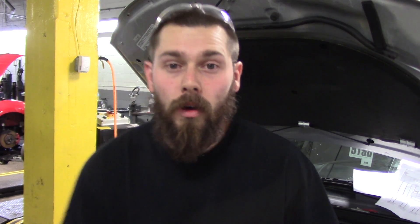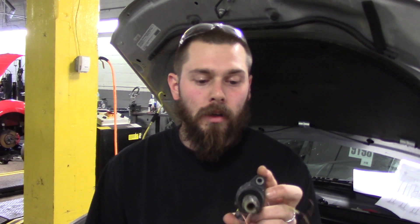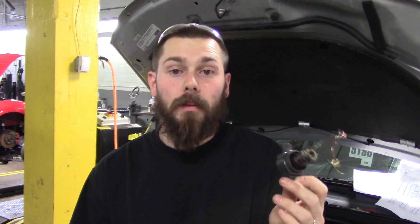So pretty interesting one — shorted control circuit on the ignition coil on cylinder three, and it melted the coil. This thing smells terrible. I was pretty surprised when I started doing my checks and out of nowhere smoke just started pouring out. This is what happens when you get a short to ground on the control wire — the computer controls the ground, and then we had a short to ground which just turns this thing on high. Pretty much what we're going to do: peel these wires up, fix them, tape the harness off really well, and obviously it needs a coil, and that piece needs dug out of there. That's going to be the fix for this car. Hope you guys enjoy this video, thanks for watching.